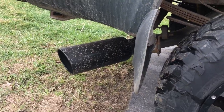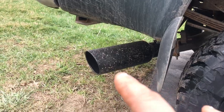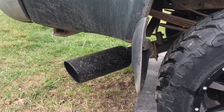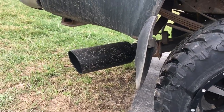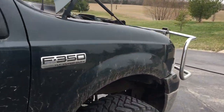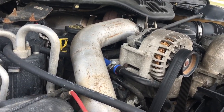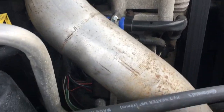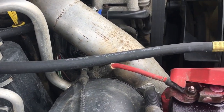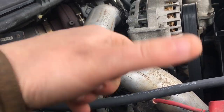All right, so as you guys just heard through our new exhaust — full 4-inch to a 6-inch black tip, 18-inch long one — you actually heard the injector missing. You can kind of hear it lope there at idle; that's actually that number one injector missing. It is on the passenger side over here, so we're gonna get this all snatched up and show you guys exactly what you've got to do: intercooler pipe, valve cover obviously, and we're gonna hopefully get this knocked out today — hopefully only a couple-hour job being number one on this side.